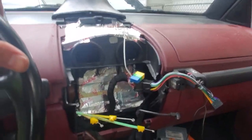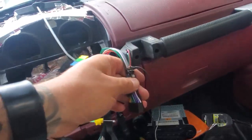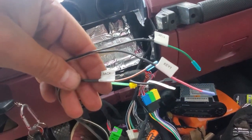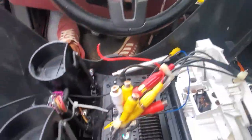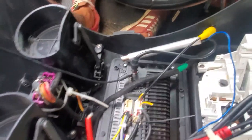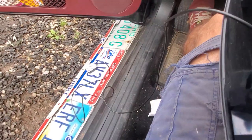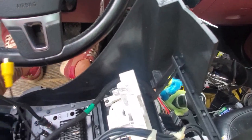Okay, that's taped up and the harness is here. If you're planning on not pulling the radio back out but you didn't add your steering wheel control, you should just tap into your wires — cut them off at the ends so that when you do run the wires you know what they are. Zip tie everything back up, heat shrink everything. This is the back of the radio — everything is in here, all zip tied, all the wires are heat shrunk. I did add an antenna adapter so you get reception. Don't forget to plug in your GPS. Zip tie these up out of the way, otherwise they're going to go into your gears and you're going to have issues with your climate control.